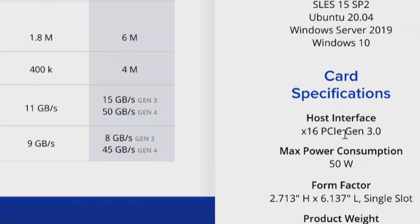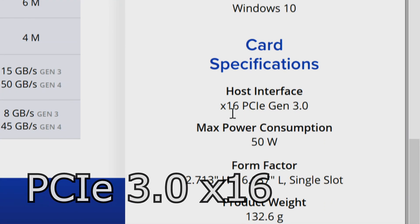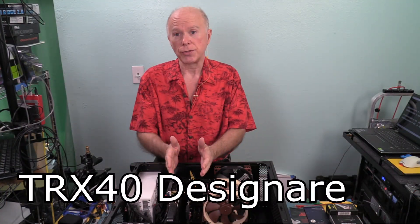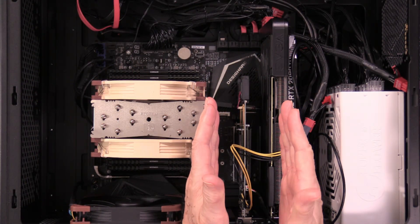Now we need to look at the specs of the card. On the card specifications PDF, the host interface is PCI Express 3.0 x16, so we're going to need a 16-lane slot — PCI Express 3 or above. Everything we're going to be talking about with NVMe is going to be PCI Express 4.0, so it'll either be a TRX40 or WRX80, because that's where the specs are. For example, in the Gigabyte Designare TRX40 where we have two 16-lane slots, if we use both for M.2 NVMe drives, we'd need GRAID to work in an 8-lane slot.